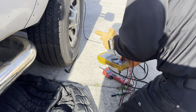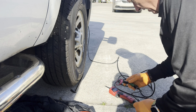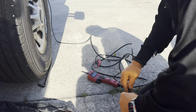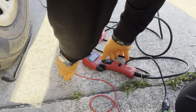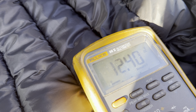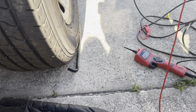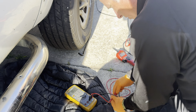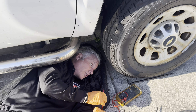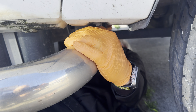Comment down below if you use the Power Probe Hook and let me know what you think of it. I'm going to connect the lead right to battery ground, so it's kind of like a jumper lead for me. And technically if I hold it here, this thing should have power at the tip — there we go. So I've got power at the tip. When I'm doing my voltage drop, I'm going straight to the battery, which will help if it ends up being something under here. I need to find the starter first — I don't know where it's at. Not a diesel guy.